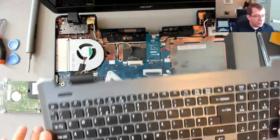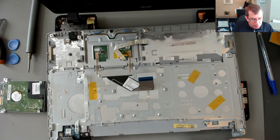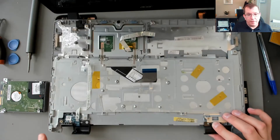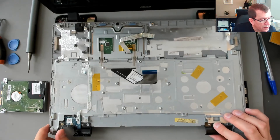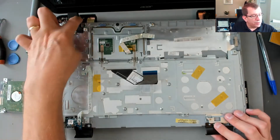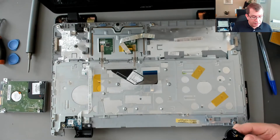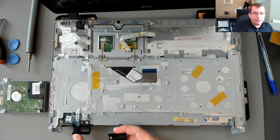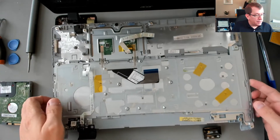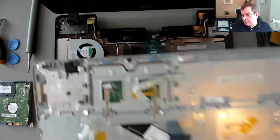There are some other issues with this computer — this side is broken off, so I might break out the super glue and glue that back on. The little plastic boss that holds the threaded insert here as well as the one back here. Back here there is a screw still coming through and stuck into a metal insert. That metal insert needs to come out and be stuck in here to match this one — this one has the insert in it, but this one the insert is still over there, ripped out. So I'm going to take the laptop away so I have a little more room and try to get that insert out of the back.